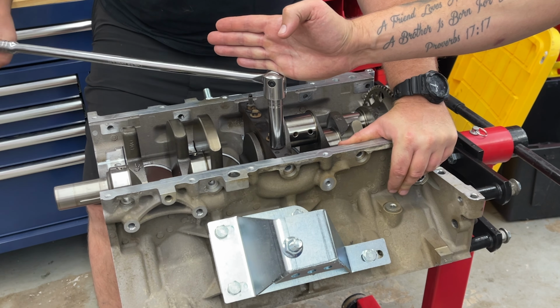This is just gonna be part 1 of putting the motor together. The next one, we will get the main caps torqued down for final assembly. Then we'll check some rod bearing clearances and get ready to finish assembling the short block. We're not too far off assembling the short block. Once we're done there, of course, we'll do the cam. So maybe the next video we'll do rod bearing clearances and the cam, and then we'll move on to timing it and putting the heads on it.